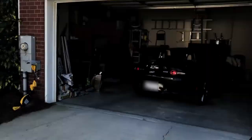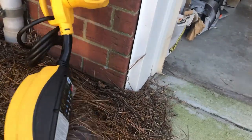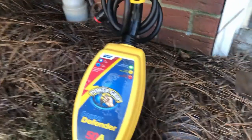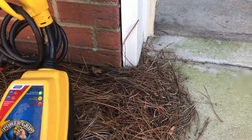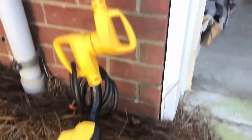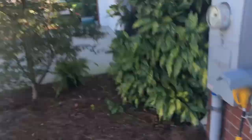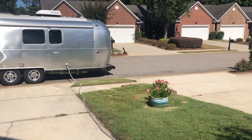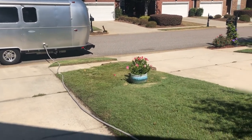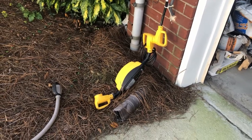The first thing I do is hook in the surge protector. You can see right here — it has a little cycle that it goes through. It's got a couple of LEDs showing you what's going on within the surge protector. So you have to plug it in and let it go through its startup cycle. I also have a 30 amp adapter connected to it, because we used to have a camper that was a 30 amp camper. If you'll notice, the cable is not hooked up yet. So what I do is hook it up to the camper first — the female end that hooks into the camper — and then run it to the outlet in your campground, or in this case at the house, and then plug in the cable.